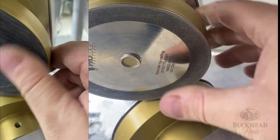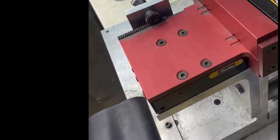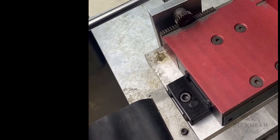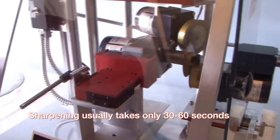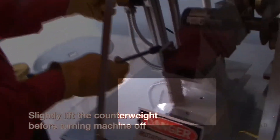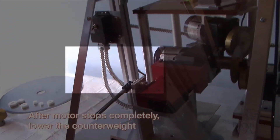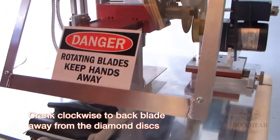This slipping has damaged the arbor to the point where it needs to be replaced — in fact, both arbors need to be replaced, and the magnets underneath them. There should be no movement around the arbor, which you'll see in the video. The balance arm was stuck in the wrong position, so I removed the set screw and put it in the correct position, which is 90 degrees to the flat platter.